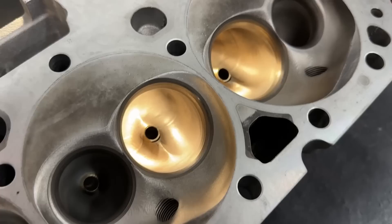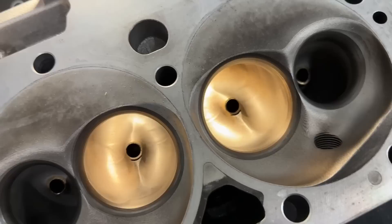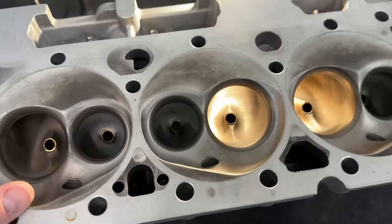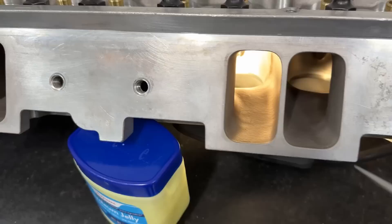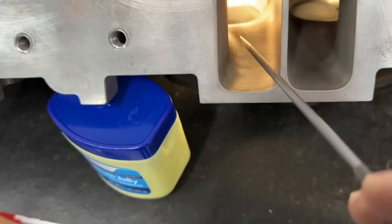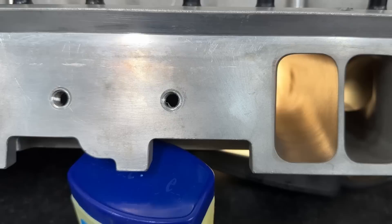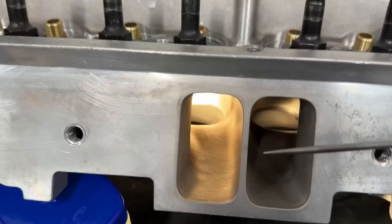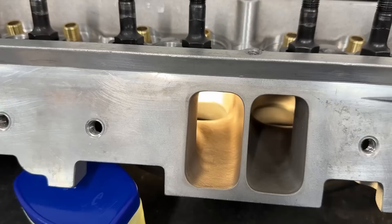The exhaust looks really good — a little bit of carbon staining but not bad. Here's the intake view, and it's a really good job there too — you can barely see that line from the tool path transition, but overall it looks really nice. Good corner radius, great port shape — I'm quite impressed. The dividers are a little thin; this is probably as thin as I would ever go. The one head I haven't seen in this cc range would be the Profiler 235cc CNC ported head.